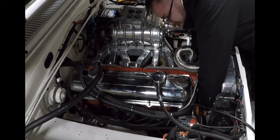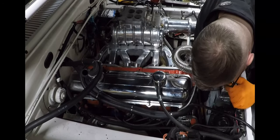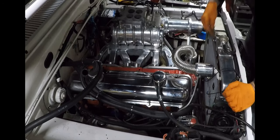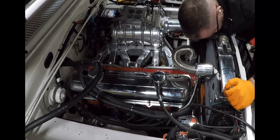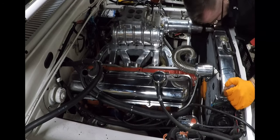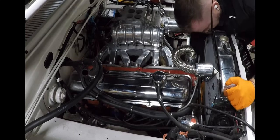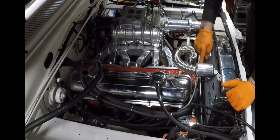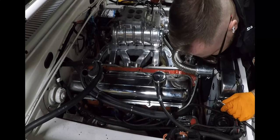I'm not trying to do any damage, but sometimes things get damaged when you take them apart. I can tell I've twisted one of the cooler lines on the trans — not even going to bother because it'll come apart just fine. What I'm really trying to do is get down there gently and not mess up the fins on the radiator. While you're in there working on your radiator, dump all your fluid, filter it before you put it back in. Since the whole cooling system is drained, it's a good time to redo your thermostat gaskets and check your thermostat in boiling water to make sure it's working nominally.